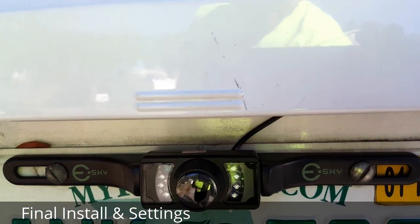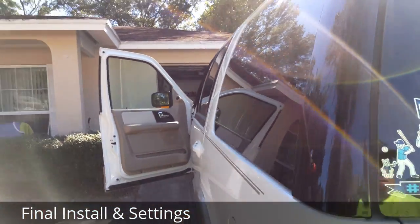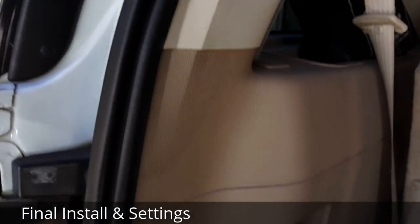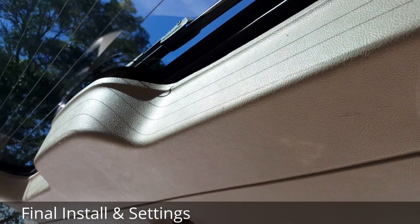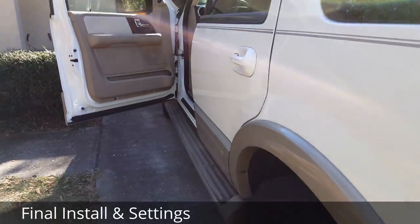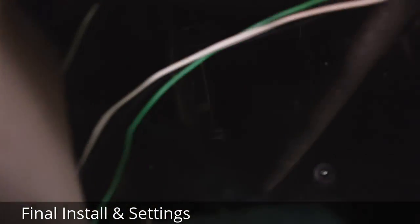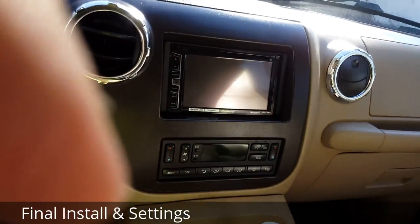There's the rear camera, guys — finally put together. I ran the wires through here, through the back panel — it took quite a long time to get it squared away, but I finally did. I have the wires going down this pillar all the way down through the side into the radio. I ended up running a wire all the way to the front because that was the only way to get the camera to work — it needed ignition power. I took all the weather stripping off and ran the wires through. The radio finally works, the camera finally works, and the steering wheel audio controls finally work.